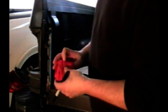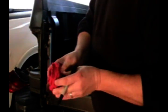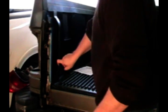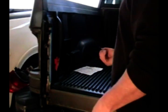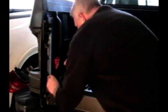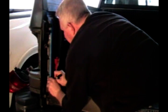Since there's a bed liner in here, it's going to be a little tight, so I'm going to take a couple of shop rags rolled up into a ball and stick them in the bed liner to open it up so I can get access to this bottom lip. Just shove them in there — it won't hurt the bed liner because it'll tuck back up in a little bit. That gives me enough room to get my marker in there and make my mark where that hole is, so I know where to center punch and drill.